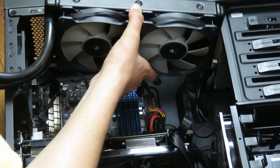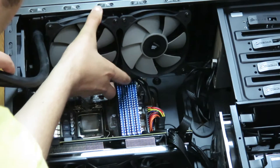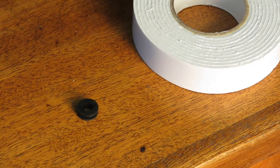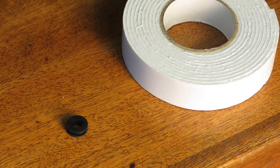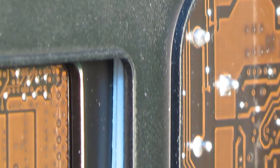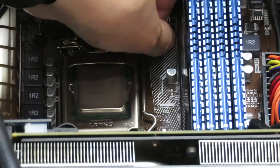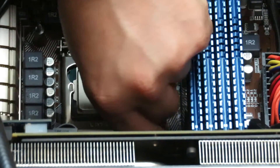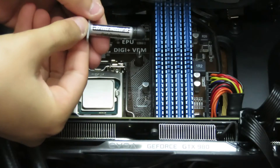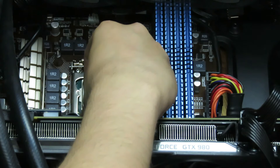You just mount the radiator back using the screws shown on the screen. For the back plate, you'll need the rubber grommets which usually come with Corsair cases, or you can pick up rubber washers at Home Depot, or if you're in Australia, at Masters or Bunnings Warehouse. Put them between the back plate and the rear of the motherboard. For extra protection, put double-sided tape between the board and the back plate to act as a cushion when the water block is mounted, to avoid the weight bending the motherboard.